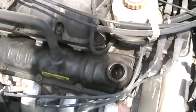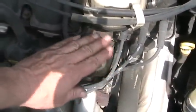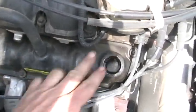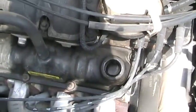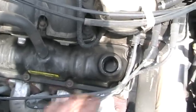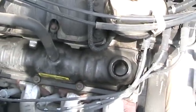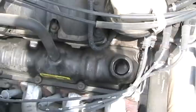If you have bad or broken rings and the engine's idling, there's a lot of smoke or air pressure blowing out of the PCV. If you have a constant stream of gases coming out of there, more so than normal, that means all your rings are bad, broken, or a few of them broken. But if it's coming out puff-puff-puff rhythmically, that means you've got one broken ring in one cylinder, or one scored cylinder, or one damaged or cracked piston — giving you an idea that you maybe don't have to rebuild your whole engine.